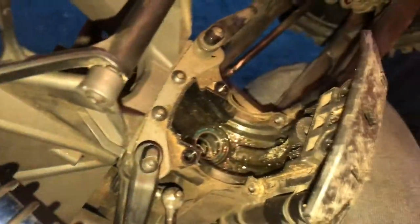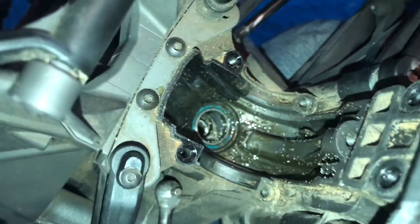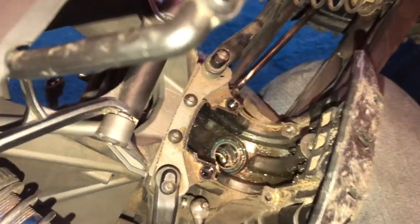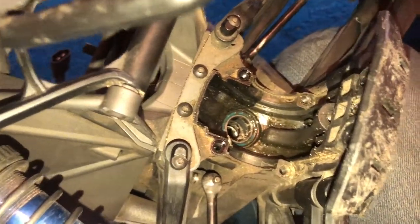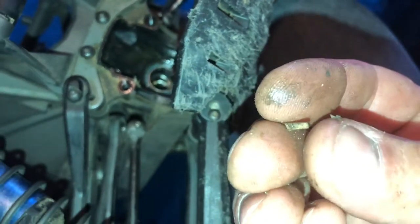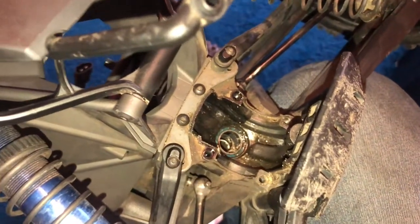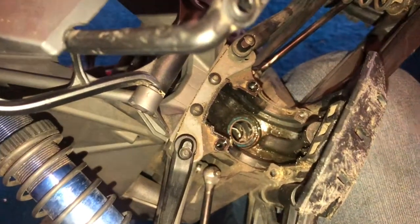When you remove your old diff, make sure you check the casing and clean it up properly. Make sure there is no sand, there is no excessive dirty grease or old grease. And also you definitely want to get rid of all the bits of teeth — there were heaps of them inside there. You want to remove all the broken-off teeth so they're not in there, otherwise they're going to get stuck in the new gear and break it as well. So I'm going to clean the diff case now.